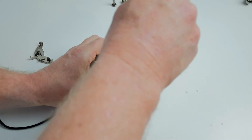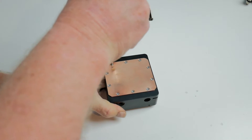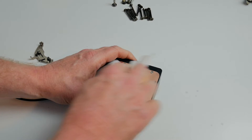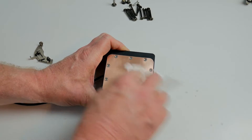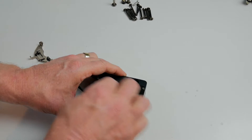This is where it connects to the CPU and it's the last place you really want anything leaking from, so make sure these are nice and tight. The base plate's on — give that a little wipe. There's still a little bit of corrosion I haven't managed to get off, but I think with the heat paste on there that's going to be fine.